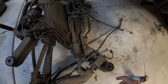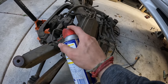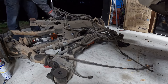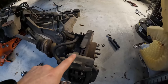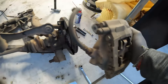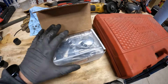I'm going to start by getting off all the brackets, bolts, and everything that holds all this junk on here and begin disassembling. I'm spraying everything down with WD-40 to make sure all our bolts break loose. Everything with the all-wheel steering is now disconnected and it already looks so much cleaner — just needs to be cleaned up since it's super dirty. We need to take these calipers off, remove all the clips and lines. Then I need to plug off this spot that goes into the rear diff — I'll show you that in the delete kit.